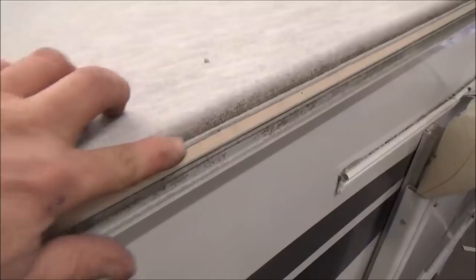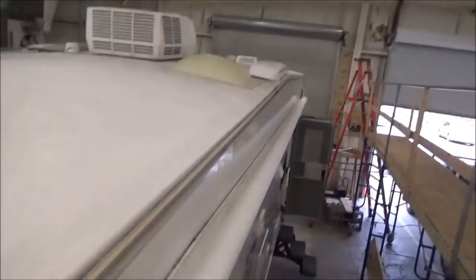Because when you deal with an old roof, this rubber wants to just shrink back. Rubber shrinks. But you can see on this coach, even on this side, no caulking. And you need to get these sealed. You can see some of the roof right there. He's gonna be up for a new roof on this thing. And then these bell caps, I don't like those at all.